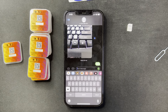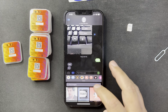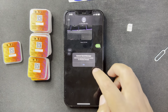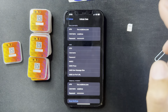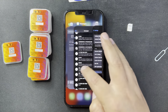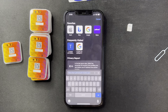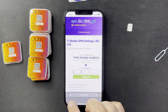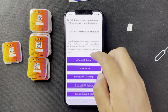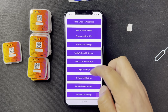As you can see I'm not on Wi-Fi. I send a test and it went out. Now let me send a test emoji — it says it cannot send. That means the APNs are wrong — the Vodafone entry needs to go, I'm going to delete it. I need to go to the internet. If you need the most current APNs for U.S. carriers, go to apn.global — this is where you get your APNs, for U.S. carriers only.